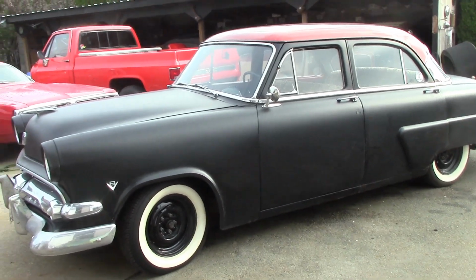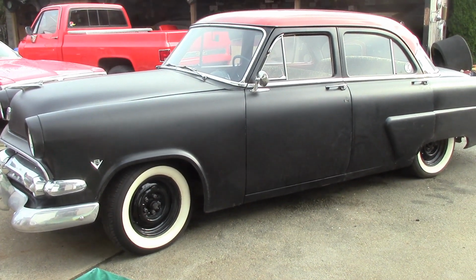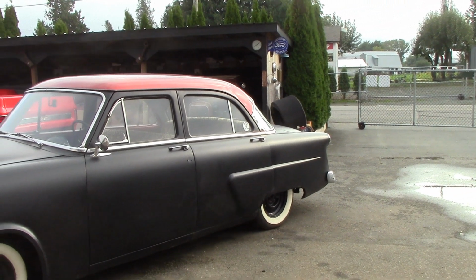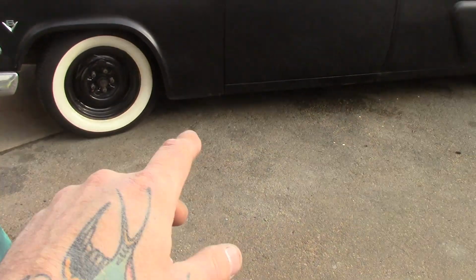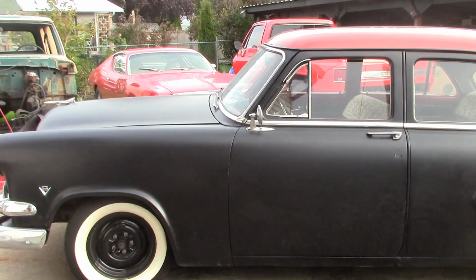So we're going to be doing a clutch on this, fixing some lights, going through the brakes, doing some welding underneath, cleaning up the undercoating, just making sure it's mechanically safe and sound, and we might be repainting the whole black half of it. Everything you see satin black, we might be repainting, because once you start getting in here and fixing, you can see there's some rust starting down there, and I believe there's some on the back here somewhere.